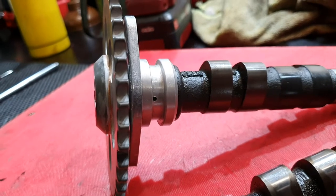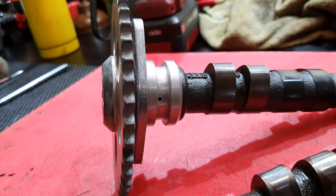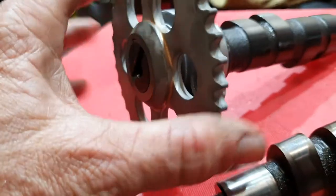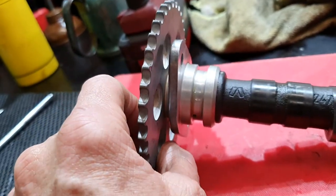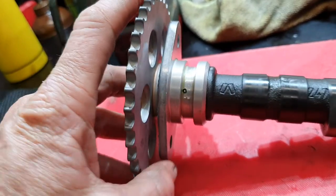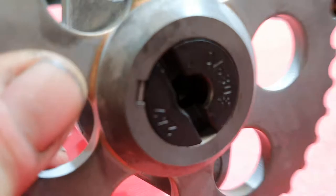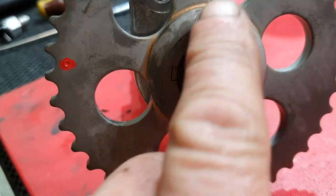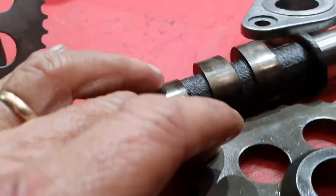Pressing on the ears of the bearing in a press destroys the bearing, bends it out of shape, and really doesn't do a good job of getting the sprocket off — it will get it off, but not before it buggers everything up. What you've got to do is put your press plates underneath this steel sprocket — not the alloy cam bearing, the steel sprocket. Then you press using a dolly on the cam end and actually press the camshaft out of the steel sprocket.